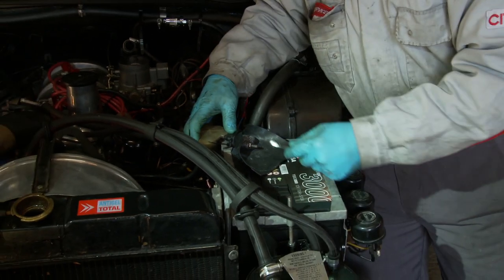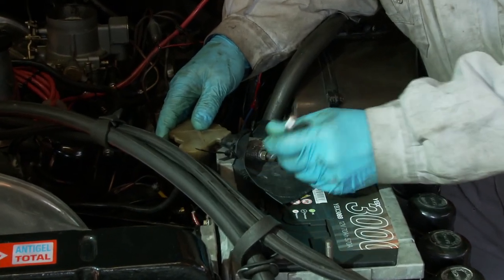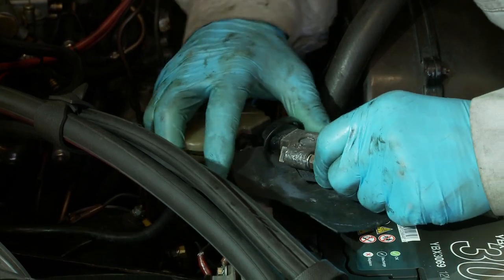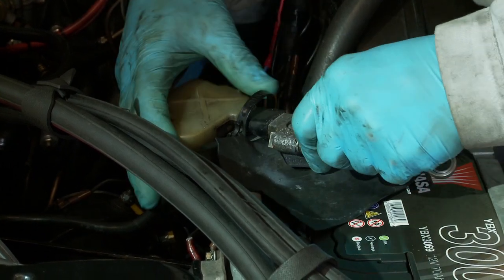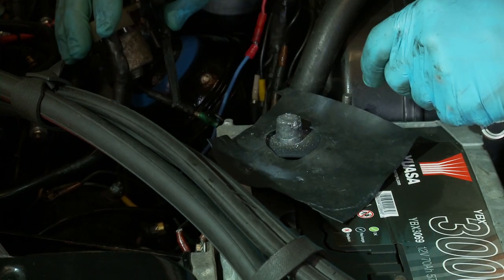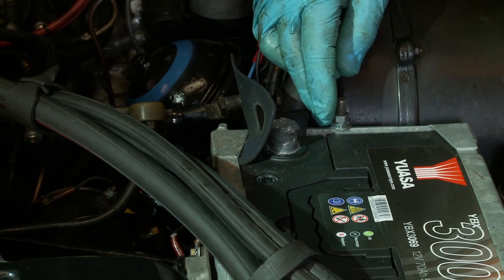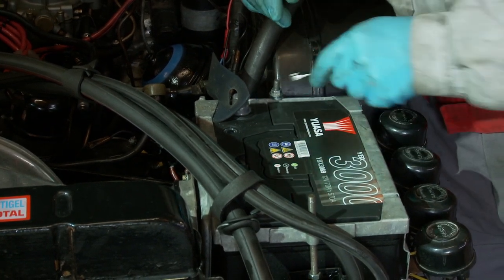Disconnecting the earth lead, which goes down to the chassis somewhere. When a car is non-standard — and quite a lot of DSs are — wires have been put in different positions. Not a real issue, it just means we have to be slightly more versatile when dismantling. Now the positive terminal, which has the solenoid relay for the starter motor on it. This clamp is closed right up tight — you can improve this by taking the bolt out and taking a sliver of lead out, or tapping it down with a hammer to open up the clamp when refitting.